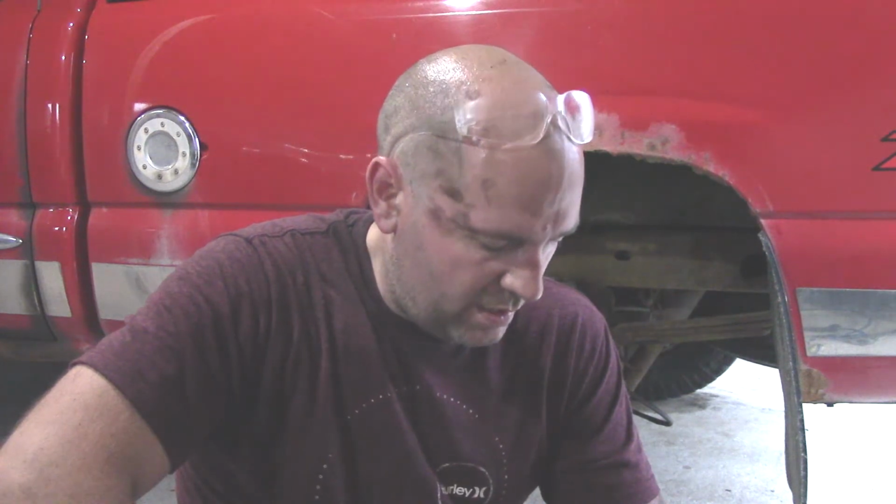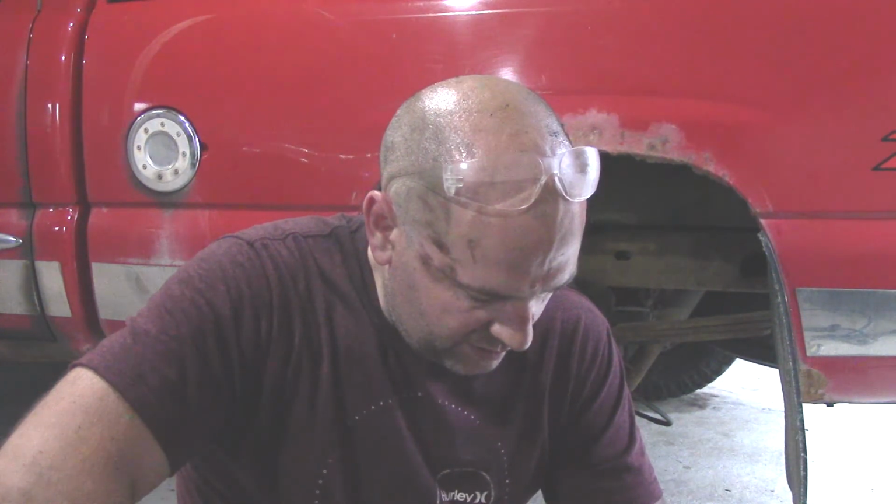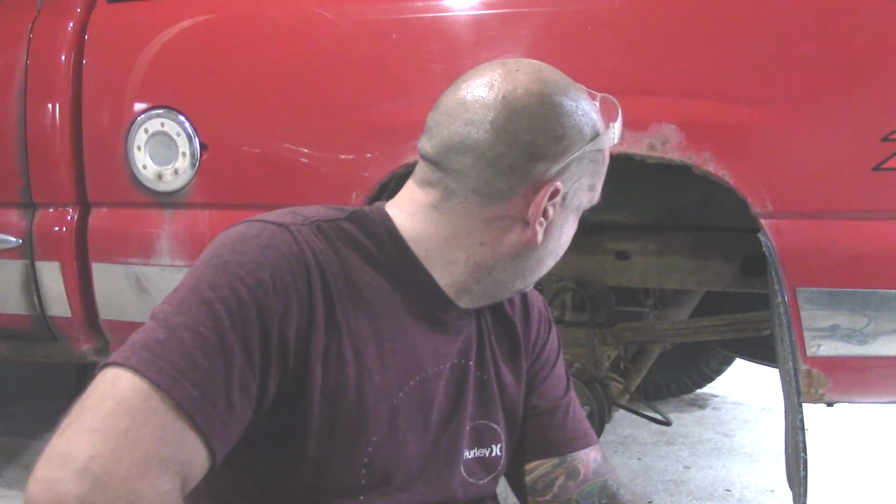So, here we are. I got the old rotors off. The heat shield disintegrated. Flex line is not bad. Not terrible. Caliper might be seized. I don't know how to diagnose the caliper good enough apparently, because as far as I know the brakes were kind of working. I don't know if they were working on the rear though. Fronts are definitely working now, so that worked.